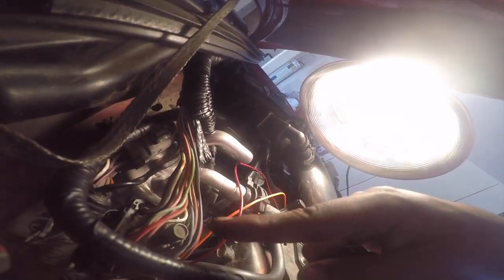So it's gonna be pin number 34, like I said. And when I looked at the picture, it said that it would be white/light blue or red, and like I said, in the instructions it refers to the cable as red. But in my car, if you guys can see, it is white with light blue, and it's connected to 34. It's right here, it says 34. And an easy way to check if it's the right cable would be to go ahead and look at the cable on your coils. Let me see if you guys can see this. I'll just show you on this side.